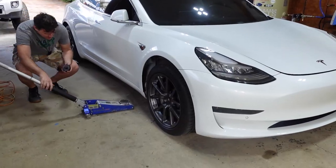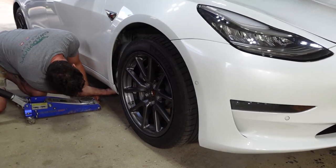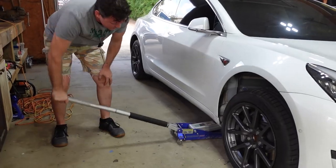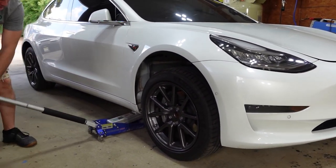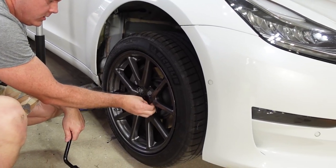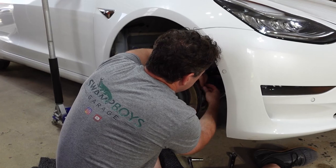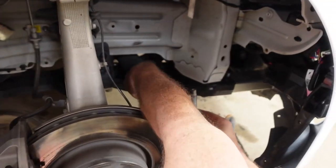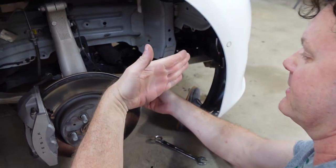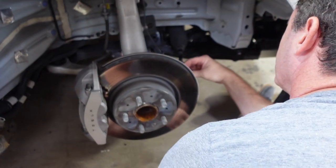We just got back. Now we're going to take the tire off and turn the tie rod one turn, since the car is pulling to the right. We're going to get that done, possibly test drive it again, and see if it's better. We'll get the tie rod out and do one turn — I think that's going to be enough to bring the front tire in just a little bit and make it drive steady.